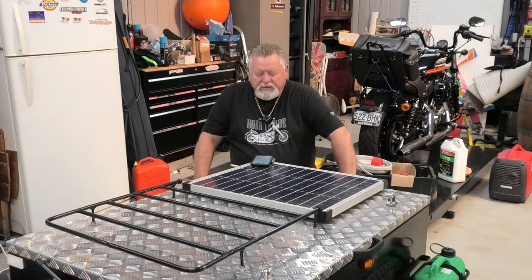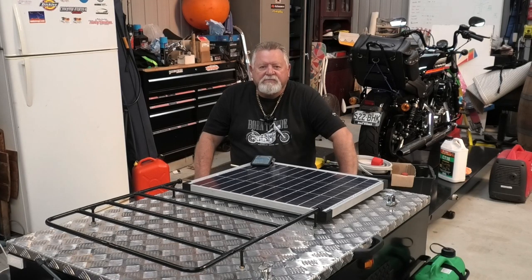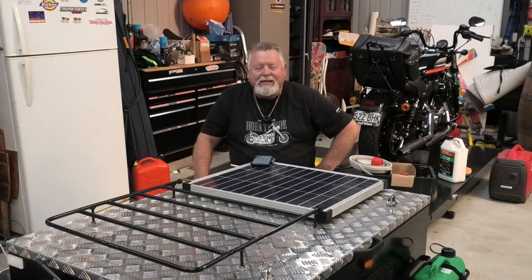Tire pressures, loaded and unloaded. You may be quite surprised how low pressure the trailers actually run on, and there's a reason for that, because if the pressure is too high, the trailer's going to bounce all over the road, because as you can see, the trailers aren't really that heavy.